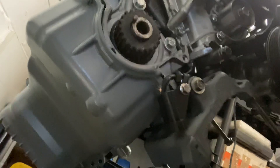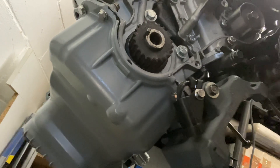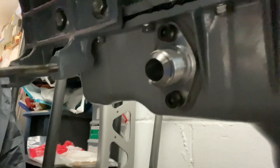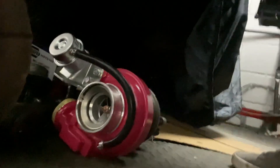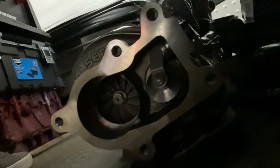The mains at the bottom are bolted up with ARP studs as well. We've also got the ladder baffle plate from the later car, so all the caps bolt together, which is allegedly a bit stronger. You might have spotted the huge turbo drain — that's AN12 — because we are fitting my shiny new Holset HE221 turbo, which has a T25 bolt pattern on the hot side and is roughly TD04-ish with an extra ear on the back.